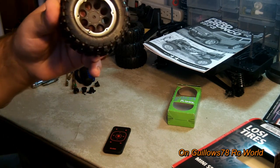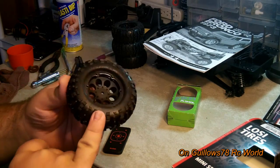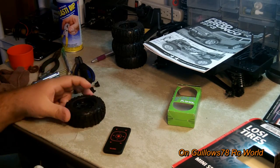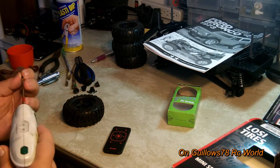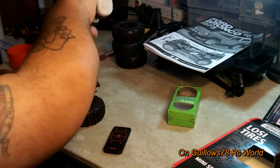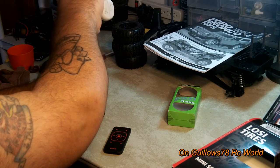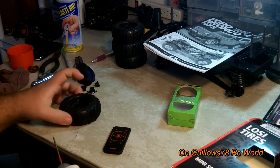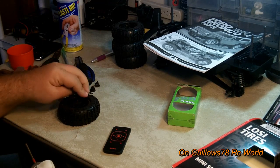It's kind of give you guys a little look. But as you can see, the ring is actually compressing the actual tire to the rim. Which causes us not to have to glue these tires in place. So when I decide to get some wheel weights for this, it'd be a lot easier to put wheel weights on my tires with the bead locks.